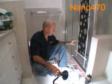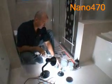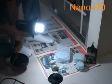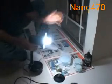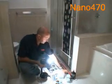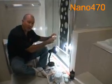Okay, we've prepared the pattern on the outside of the glass. What we need is our bevels to be put on, our polished edged bevels. We've got 1.5 inch, 2 inch, 3 inch and 4 inch bevels, and our white light. Now, curing using a white light must be done from the back side of the bevel. Don't cure using a white light from the front, because as we put the bevel on and we hold the light here, the light actually goes through this facet around the outside and disperses the light, so it doesn't cure